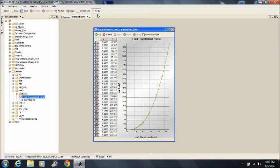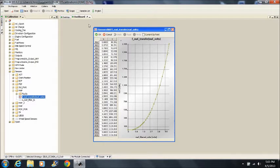Remember, when entering the transfer function, be sure to set the English metric button to whatever units you are entering from your transfer function sheet. Pro-M transfer function sheets provide airflow data in both kilograms per hour and pounds per minute. The tuning software will accept either English or metric values, but you must set the English metric button appropriately while entering your values. Also, if entering the values in English, please note that the tuning software is looking for values in pounds per hour. The Pro-M flow sheet provides English flow values in pounds per minute, so those values will need to be multiplied by 60 before entered into the tune.